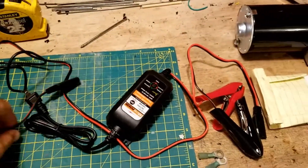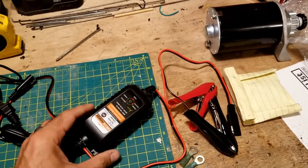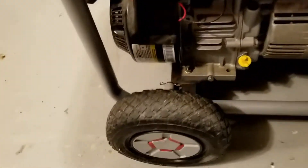I'll show you where that's going to go. I've got a trickle charger which we're going to adjust and rewire because this is going to be the actual charger for the machine and for that battery. This is called a flywheel puller. I'm going to take off the old flywheel because after I removed the shroud I found out it does not have teeth, and if it does not have teeth you cannot do this. So you have to replace the flywheel and put one on with teeth.